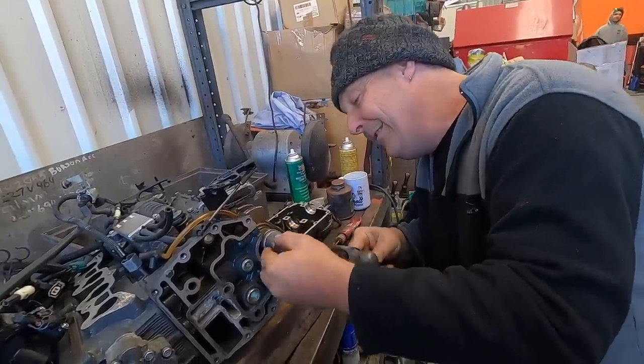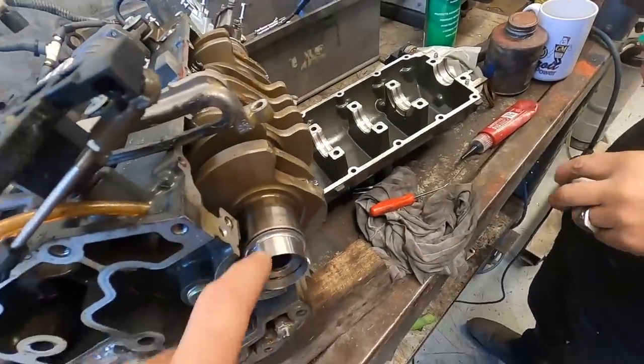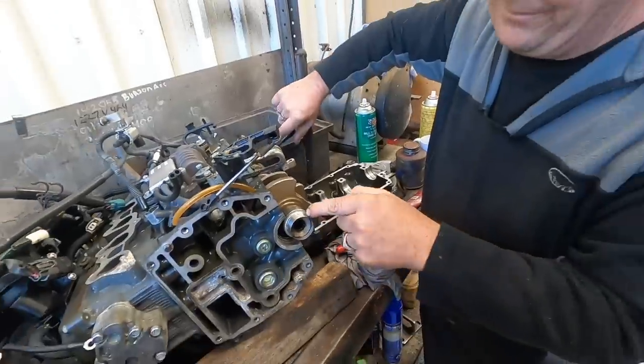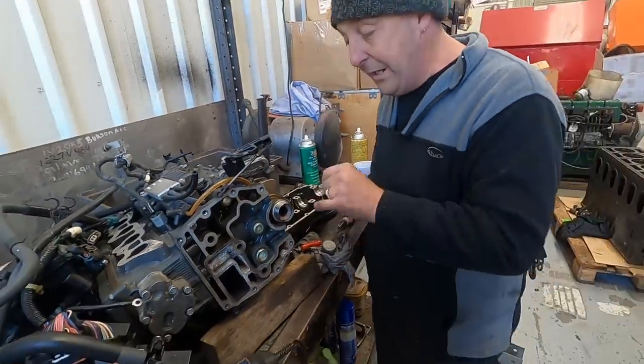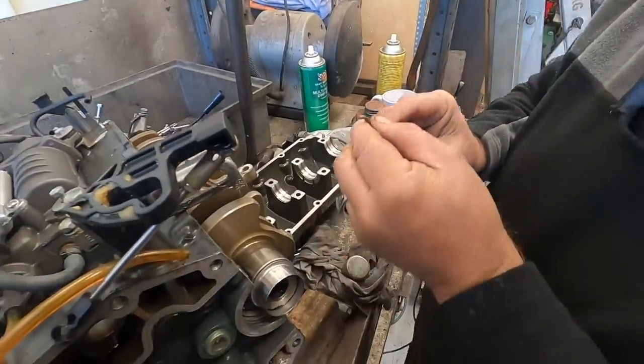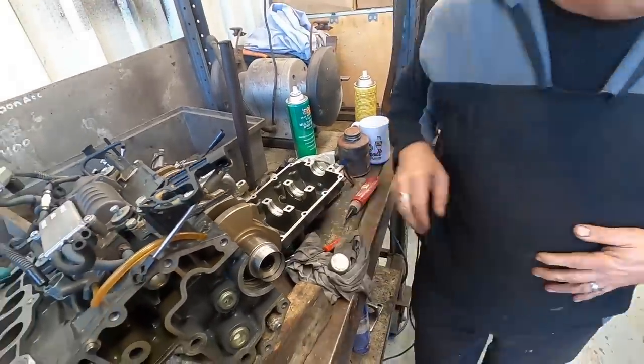There it goes. I'm going to leave that like that to give me a bit of room to get the... Yep, to cut the flange. And you were saying if you cut the flange before you put it on, you find that it starts to splay a bit. Spread and then it wants to tear off. Yeah. Also, if you're really good, get a little chisel. You can hit it there and it'll actually start to bust it open too.